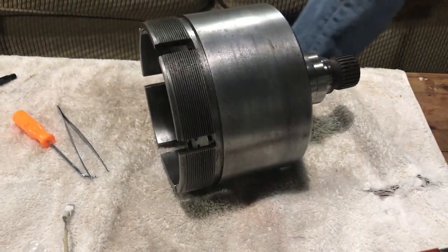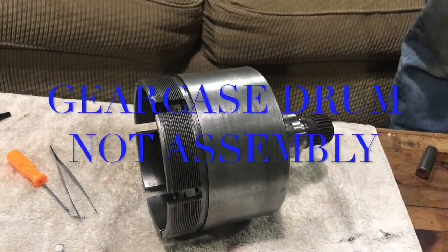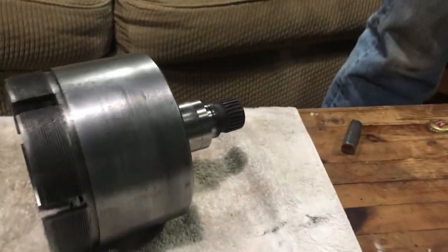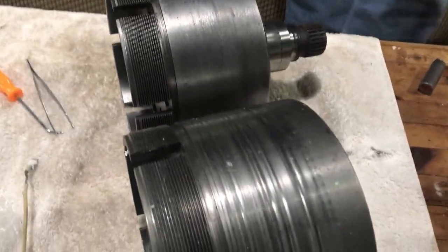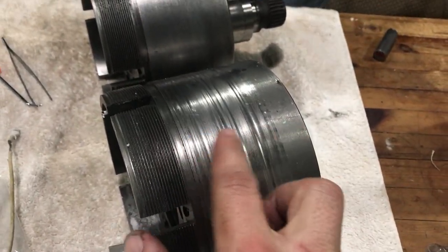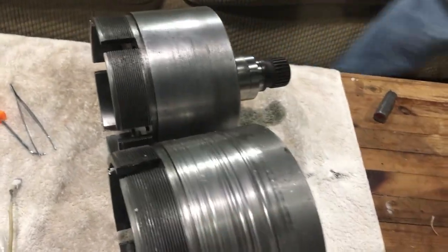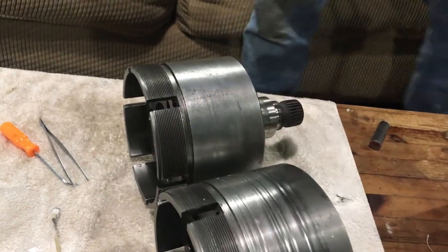We did order a new gear case assembly. We couldn't get the old one turned down easily. I'm sure if you absolutely had to, you might be able to find a machine shop willing to do it. There's our old one. And man, it really looks bad now. All those gouges and everything else. We kind of assume when we pull this out, oh, this needs to be shiny and smooth, and it really doesn't. Needs to have almost this rough, like a rotor on a car, texture to it so that reverse band assembly will grab.